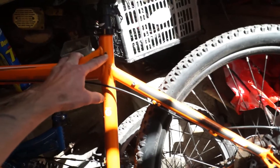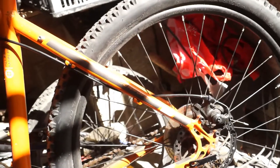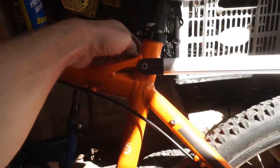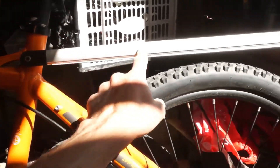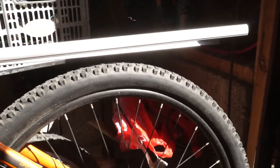I've drilled a hole here which is going to hold my mount for the battery. I'm having some aluminium coming across here and then down to this brake bolt. I'm going to put a longer bolt in and extend it, so it's basically an aluminium frame going across there. How simple was that — one hole. It's aluminium, this frame, so it's very lightweight. The bike probably weighs 10 kilograms, maybe a bit more. It's got a bolt with a wing nut on the other side and that's my horizontal piece — I'm going to mark that off now and cut it.